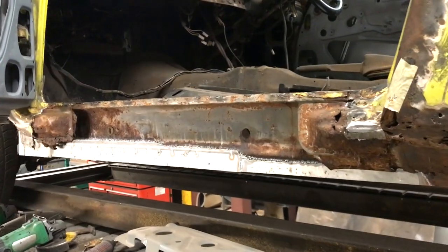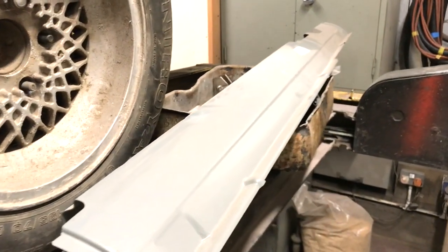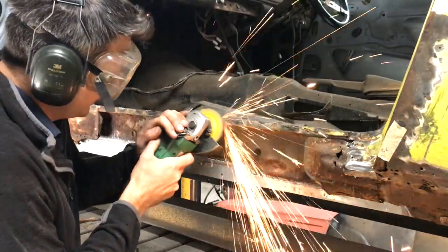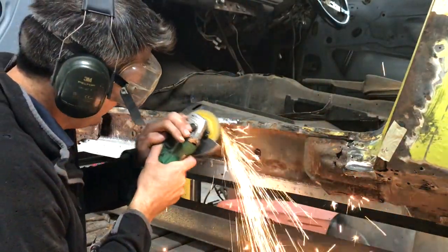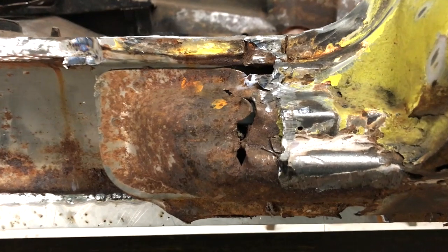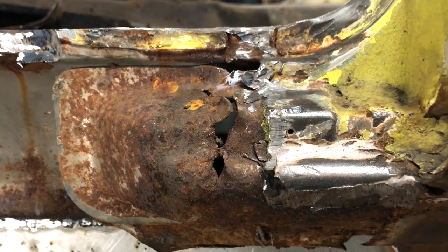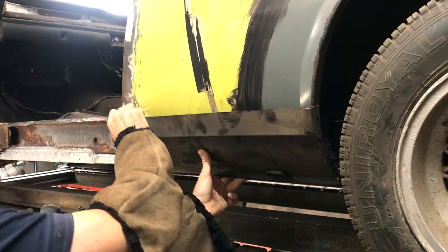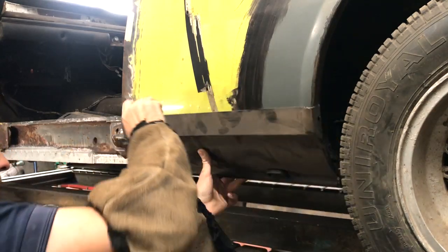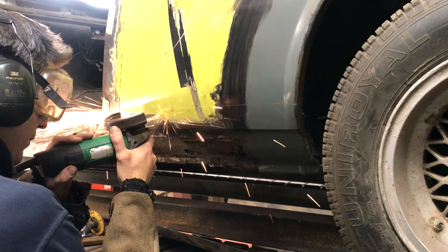The innermost sill is repaired, but there are still the remains of the sill membrane. The outer rear wing has to be replaced and I've got a complete outer sill to fit. Because I can't see where the spot welds are, I have no choice but to grind the remains of the old membrane rather than drill. The tool of choice by whoever removed the sill membrane was an air chisel — obviously not a rare BMW enthusiast, or perhaps not even a motor vehicle enthusiast. Perhaps they only had limited time before having to go and move some cattle. We will never know, but hopefully the cattle got moved safe and sound.